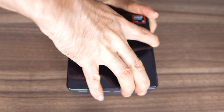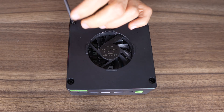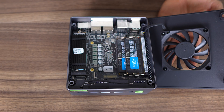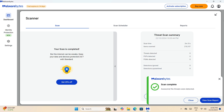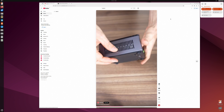Like its younger brother, the M7 Pro opens with a twist, which is something a little different — still has screws underneath though. Dual-channel DDR5-4800 is the maximum memory speed this CPU supports, and you have dual M.2 Gen 4 slots for storage. The included OS drive is only Gen 3 and comes with a heatsink. Underneath the SSD is the M.2 Wi-Fi card, and everything is cooled by the top fan. Windows 11 Pro is included with the pre-built options, and this Mini is malware-free. Ubuntu worked fine on the M7, so unsurprisingly it works fine with the Pro as well.